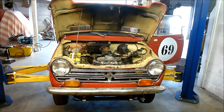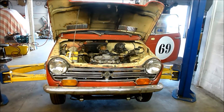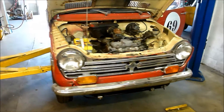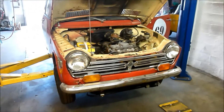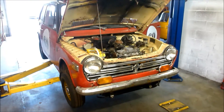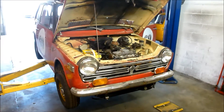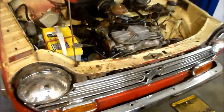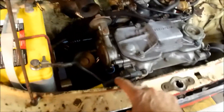We're in the shop with our little 1970 Honda N600. This car is recovering from an electrical meltdown. Still don't quite know how it happened, but it's resolved now. I have a new heavy-duty two-gauge ground strap going from the engine to the body, as a lot of people pointed out I didn't have.